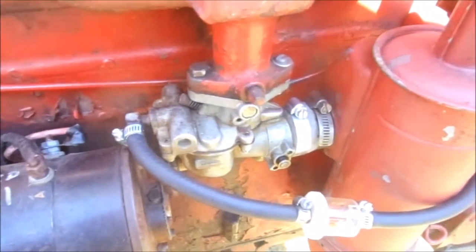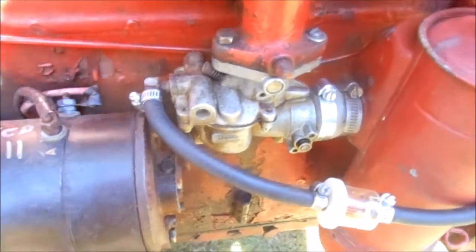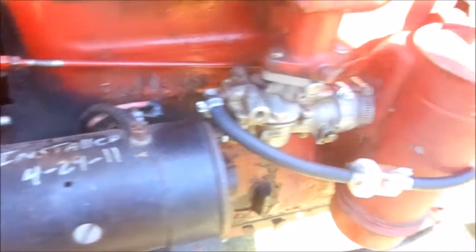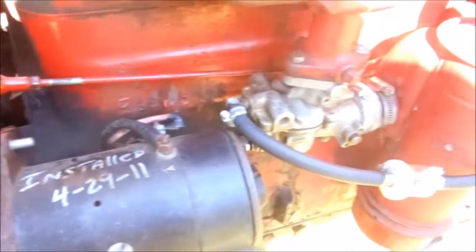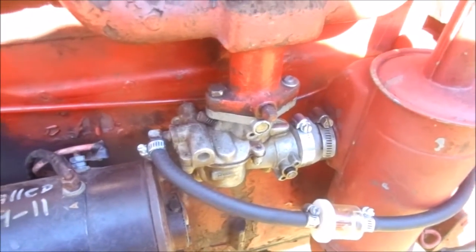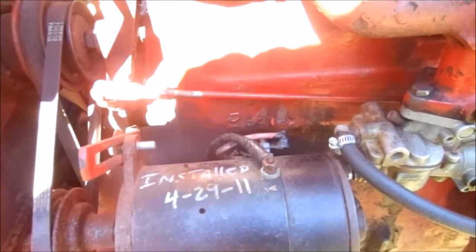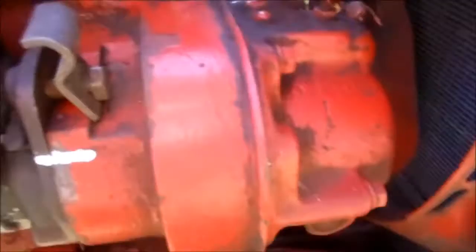So I'm putting this all out there, guys. The tractor will start pretty easily with the battery. I cannot get it to hand crank. It just won't pop. I must have pulled that hand crank around half a dozen times. Even when it's warm, even after I have it running, I shut it off and try to hand crank, it won't start. But it kicks over relatively easily with the battery. She runs good, but only at mid to high idle. I have no control of that idle. So again, my biggest puzzle is what guys are telling me about this cover here.